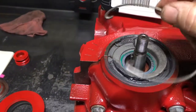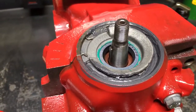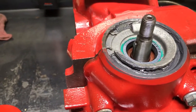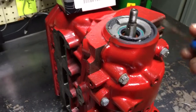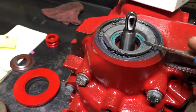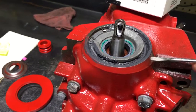I want to look at this snap ring. The snap ring always pops out on these little guys. What I do is silicone them in — I just take some black silicone or blue silicone, whatever color you want to use, and dab it in around the groove with the snap ring firmly in place. Clean it first with brake cleaner or something like that. Silicone is a great product if you've got a really clean surface and if you allow it time to set. Too many people put silicone on and put oil in right away. 24-hour curing at room temperature, longer if it's colder. I've seen silicone weeks later at around 32 degrees Fahrenheit and it's still not set up.